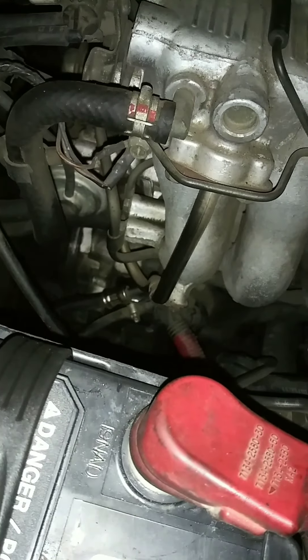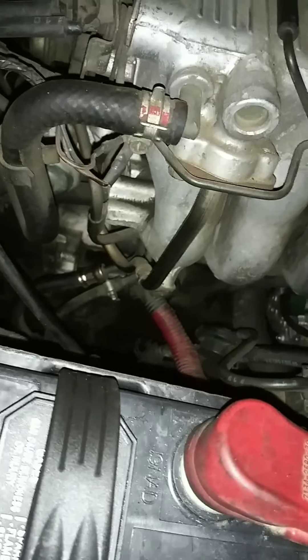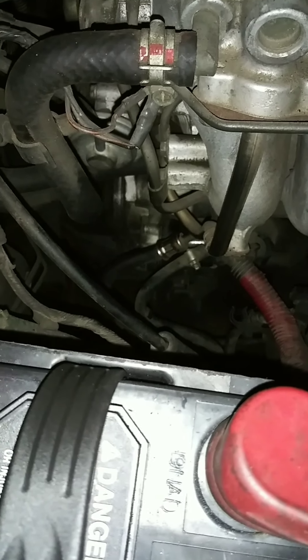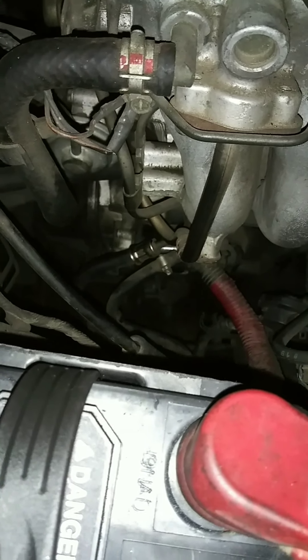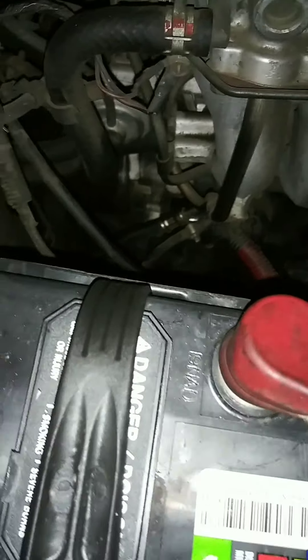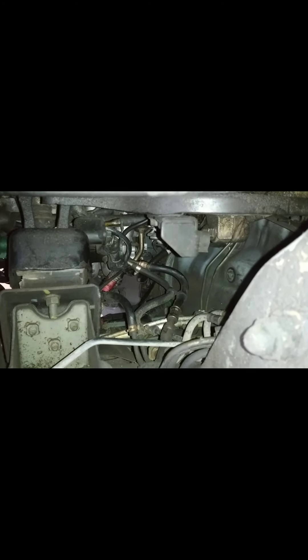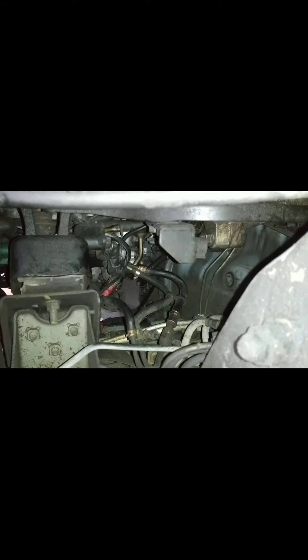Next is the starter. It's got a little bit of silver — you can see it at the bottom underneath those two hoses, a little bit to the driver's side of those two hoses. Starter's out. I put the two bolts back in place so I don't lose them. It was two wires — this one stayed on. That's where the starter was, above where the connector's just hanging.